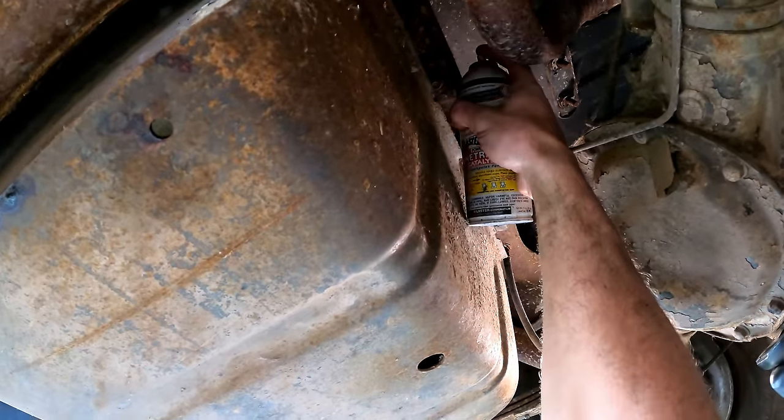We've got the cartridge filter, the pump, and then another inline filter after that. The inside of the fuel filter wasn't too bad — some surface rust, but could have been reused. On this inline pump I tried applying 12 volts — nothing. I got this jump pack at about 15 volts — let's see if that does anything. It's pulling a load, I can see it sparking and hear it trying to turn. The tap test — things loosened up in there, I hear it making a little noise, but that's it. This is not rebuildable. I'll find a new inline pump tomorrow.